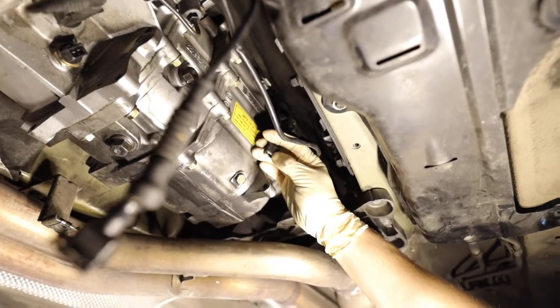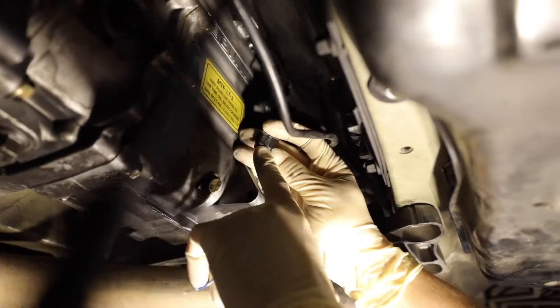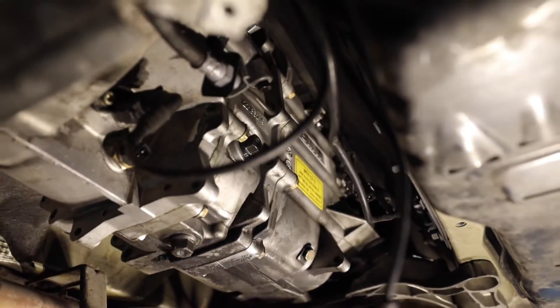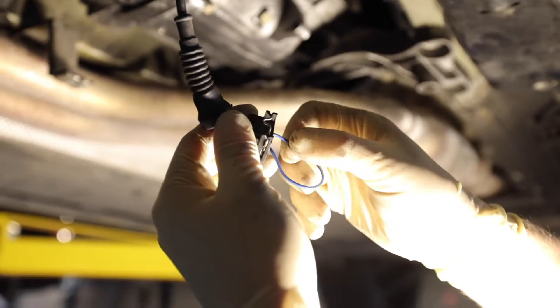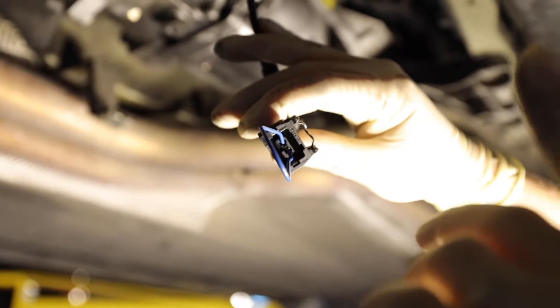To do so, you're going to cut off the plastic guide — there's a little plastic guide on top that we have to cut. On the old wiring the guide was right on the edge; on this one the guide is right in the middle, so it won't fit in your connector. All you have to do is cut this little guide off so you can slide it in. For testing purposes we leave it open for now — just plug a simple wire into the connector to create a closed circuit. This way we can find which wires we're going to use from the SMG module. Let's get to the SMG module box and look at the connector.